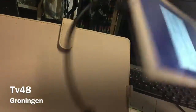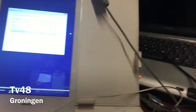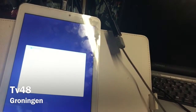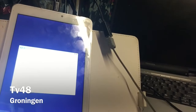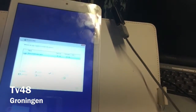I'm also going to remove the SD card because Android is installed on it — I don't want to accidentally kill it again. Android is installed on the SD card and we're fixing Windows. We're going to delete all the partitions — hit delete, delete, delete until we have one partition left.